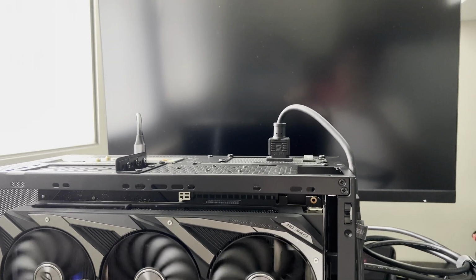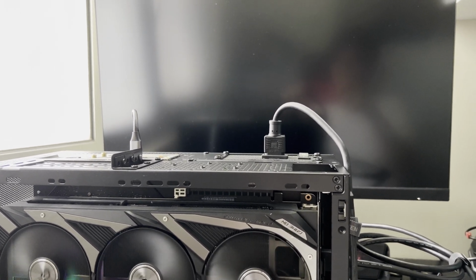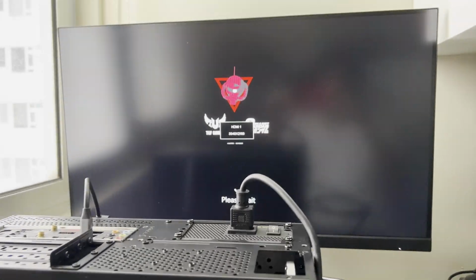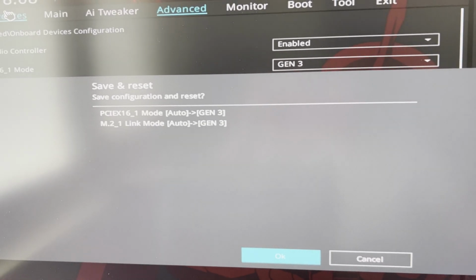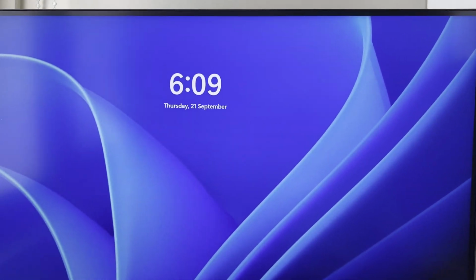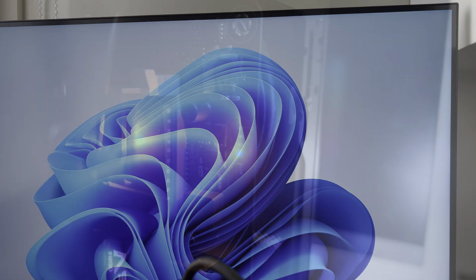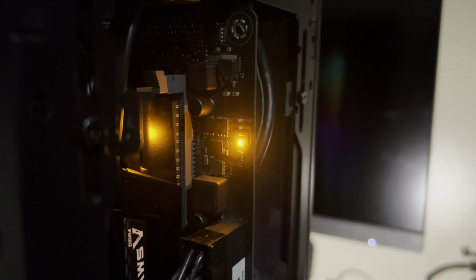As for the troubles in my builds, I was entering a boot loop with the B550M Zaku with RTX 3070. It will actually try to go to Windows and then restart. This happened after I installed the driver. I tried to set the GPU link to Gen 3 instead, and it went to Windows successfully. This means that either the riser is actually just Gen 3 or I destroyed the riser by stretching it and accidentally downgraded it to Gen 3. I think it is the latter though. I actually encountered more issues but not related to Meshroom S, which will be detailed in the next build video.